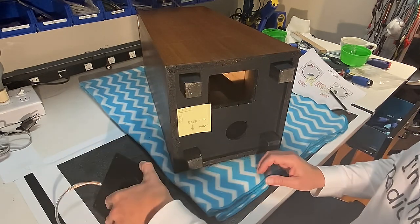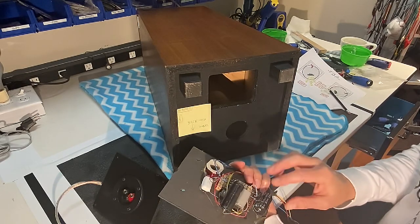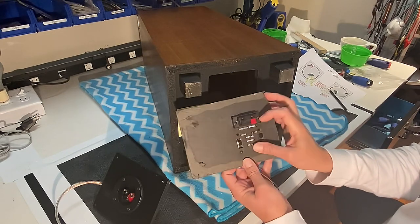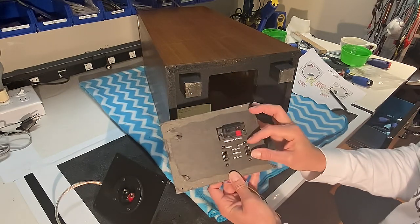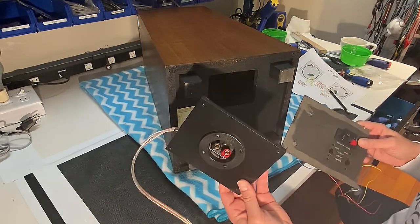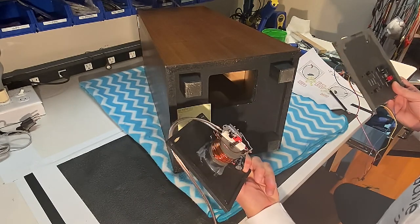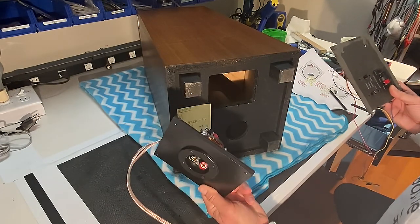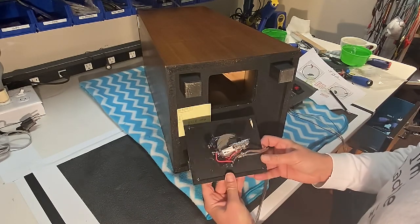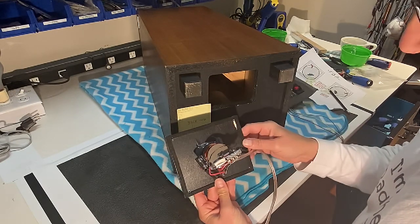Again, the old crossover also provided bass enhancement and treble enhancement and provided switches on the outside, so it was a little bit easier. But that's the choice they decided to make on this one, to not put the switch on the outside. Not sure why. Certainly could have been done. Make things a little easier, but I guess the bonus is that once you set it, nobody's going to change it and it won't accidentally get changed if it was, I don't know, rubbing on the carpet or what have you.